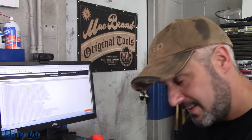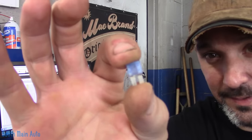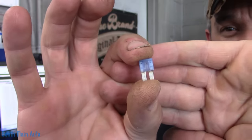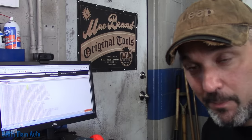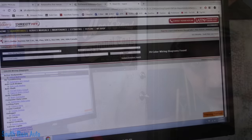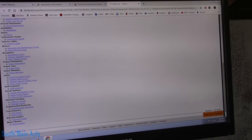I'll tell you right now, the vehicle has a blown fuse — they're special little fuses with a kind of narrow spacing on them. Fortunately I had some. Where do we go to see why it won't turn on? I just went on a wiring diagram. So I just looked at the starter circuit — what does it take to start this car and turn it on? I know it has the wireless ignition node, the ignition module, the little button that you push — but where does it go from there and what does it need to see?